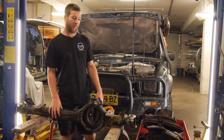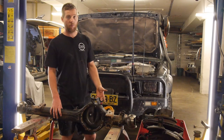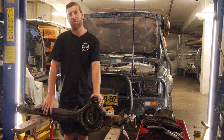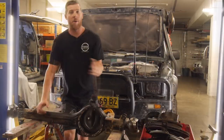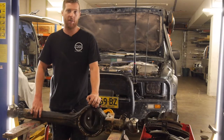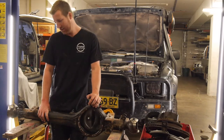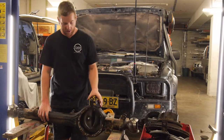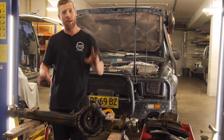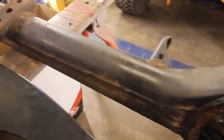The weak point on a solid axle would probably be the CVs, but I haven't broken any on this so I'll drive with a bit of mechanical sympathy. Anyway, I could probably stand here for hours talking about pros and cons, but I've made my mind up — I'm gonna do it. So I guess we'll run through what my plan is. As you can see, I've got an actual housing and, for those keen-eyed viewers, you'll probably notice this is out of an LN106 Hilux — the unbreakable Hilux.